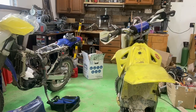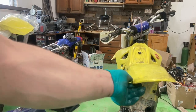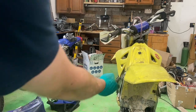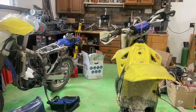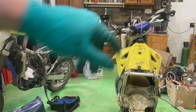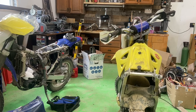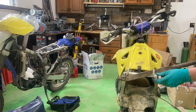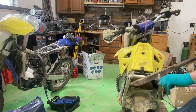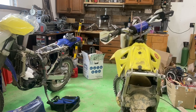So apparently the subframe's bent — this side is likely lower, pulling that fender down as you can see. I've got the fender unbolted so I can push it back in and reference it. I haven't really seen much in the way of videos on how to straighten a rear subframe. Just looking at it I can see one side is lower. I come from a heavy-duty background, and usually when we fix stuff we do stuff like this.